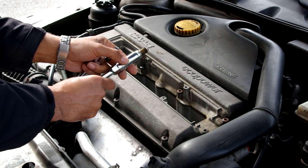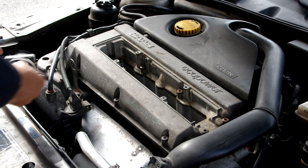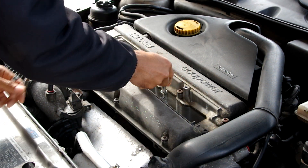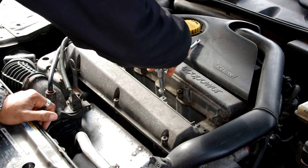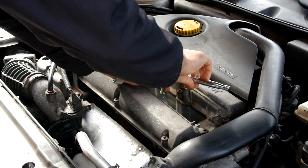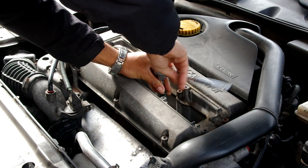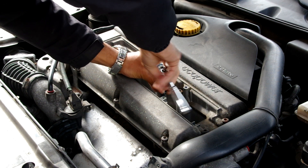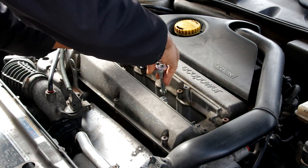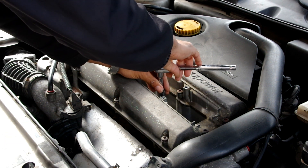Take the opportunity to look at the spark plug. These ones were okay — they weren't completely fouled or anything. They weren't run too hot, they weren't too cold. The gap was good. There wasn't a massive residual amount of fuel, and there was no oil in them. But when you do remove the spark plugs, take a minute to look at the quality of what you're pulling out, because that will be a telltale sign if there's an issue somewhere else along the line that you may want to take care of.